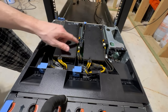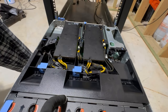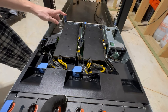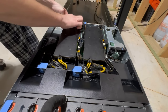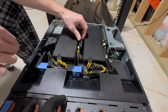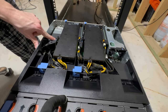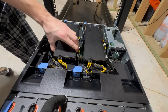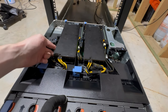That's the second cable routed — under and through, then just pop out and shove everything in here. Not the most graceful solution, but it does work. I have two P100s in another machine and haven't had any heat issues, so I'll report back if I do. Now clip everything back in place to get the GPUs locked in. Press the blue button on the side — it'll be a little stiff — and that locks this GPU in. That's how to install two Tesla P40 GPUs in a Dell PowerEdge R720 server.